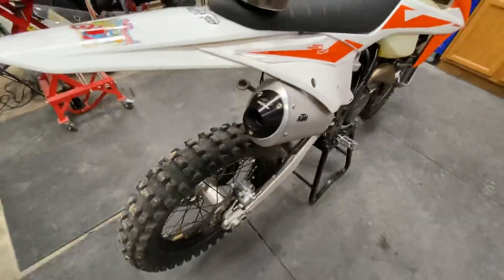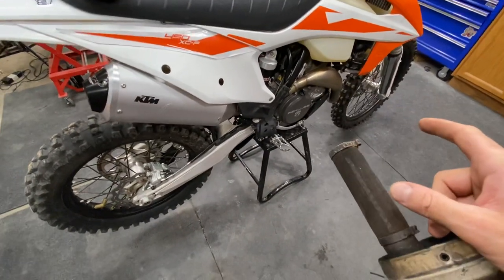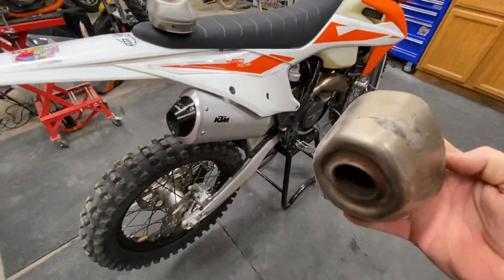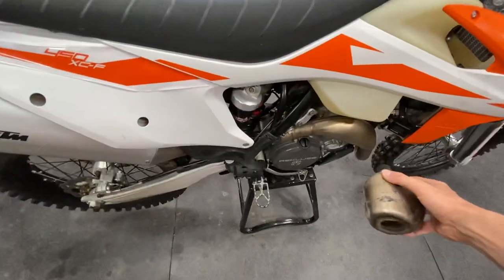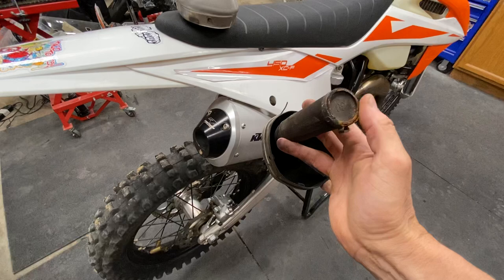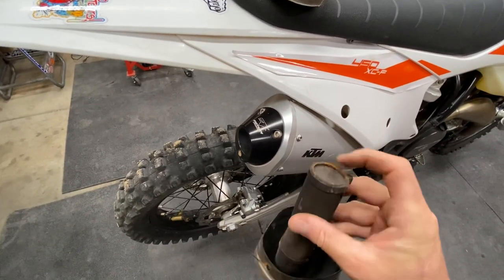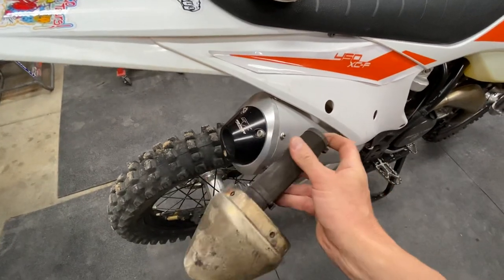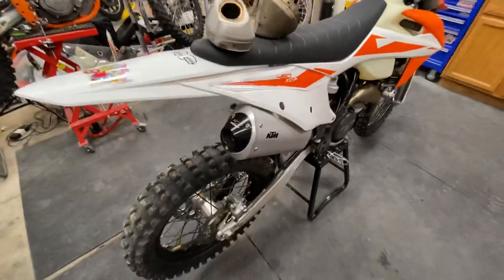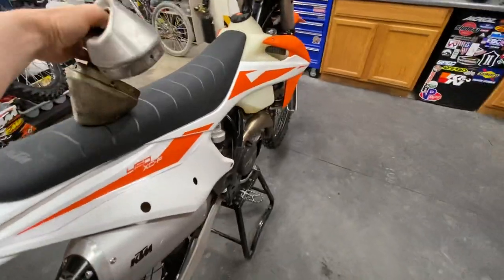This is an XCF, so the 450 engine is the same engine that's in the EXC machine — different mapping but the hardware is all the same. The XCF and SXF bikes have a different header pipe than the 500 and 501 Husqvarna version. The street legal dual sport has this obnoxious 30mm plug — so you've got a roughly 42mm ID through-pipe and then you're sending a 30mm obstruction straight into that. Think of all the heat retention and power loss on one of those street-legal bikes versus these motocross bikes. These motocross bikes are very easy to put on an end cap — you don't have to change the mapping or do any fuel mods whatsoever.